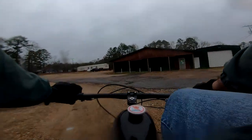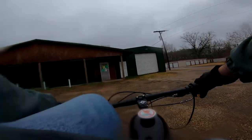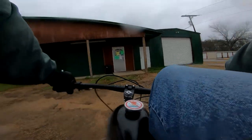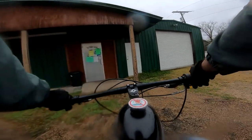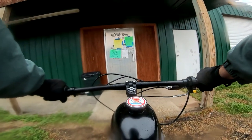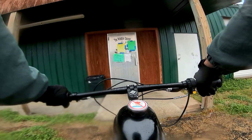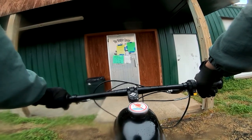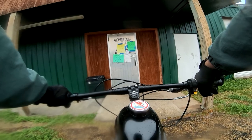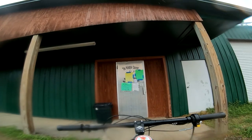Apologies for the slightly canted camera angle that always makes it look like my handlebars are crooked, but I assure you, they're straight. Anyways, it looks like we have a bit of tuning to do, as I expected we would once adding the pipe to the motor. It definitely changed things. You really do notice, once you add a pipe, just how out of tune your motors can be. Lots of misses and four-stroking and all sorts of random things that you just can't hear with the stock setup. I also suspect that we might need to tweak the timing on this motor as well.